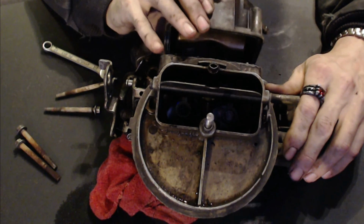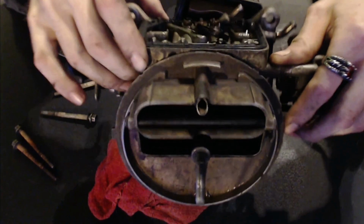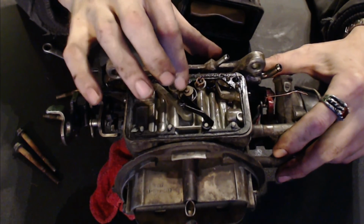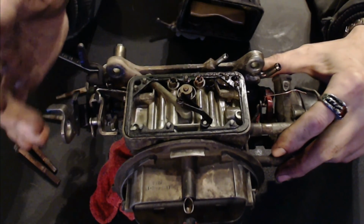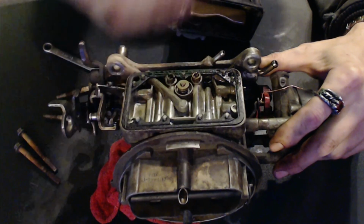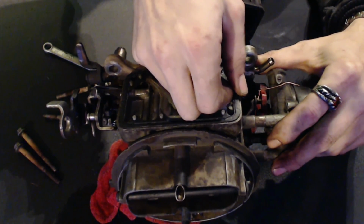And what do you want to bet? Yes, that is exactly what has happened. You see what has happened here? The little plastic piece didn't come all the way off, but it fell onto the power valve here, which is causing a lot of problems for it, like surging and that kind of thing. So I figured out what's wrong with my setup here. This little piece right here, this is the culprit. Okay, so what we're going to do is lift up this gasket very carefully here. If we can get it off without breaking it, good; we may have to buy a new gasket if we do.